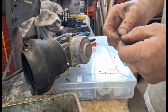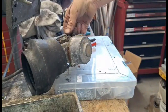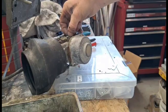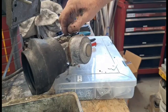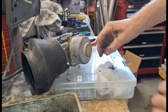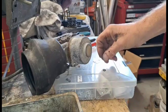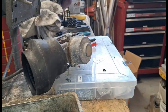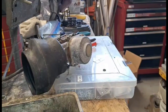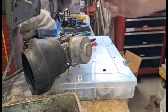And this O-ring, it's about 1/4 inch ID. It goes right there when you put the accelerator pump. It goes right there when you put that valve, shutoff valve. The anti-dieseling valve that goes on the side of the carburetor, we just call it a solenoid. Alright, so that's how you replace the O-rings in the carburetor.